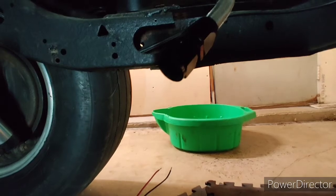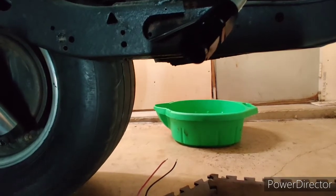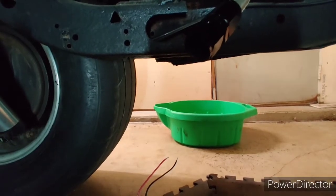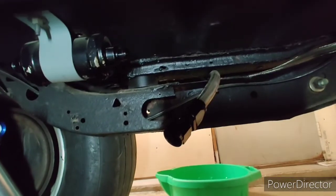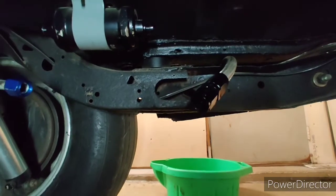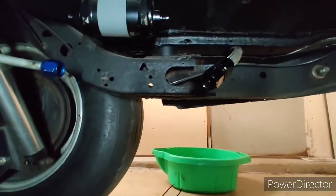The other problem is that I have a flat sump. I have adjustable brackets. What I'm going to end up doing is cutting up a piece of square tubing and putting it on the backside of the fuel cell so that it's got some tilt — just so I don't run into that problem because I don't have a drop sump. My fuel cell is on the floor of the trunk; I didn't cut up the floor. I consulted with JJ about that. JJ is the one who actually tipped me to that.